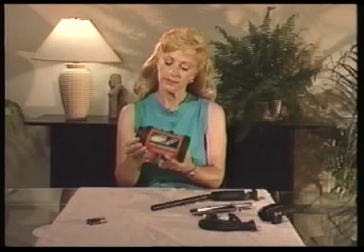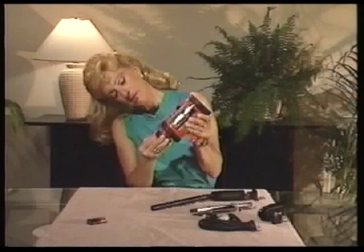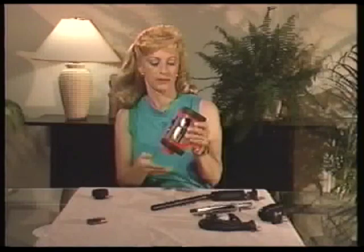To start your speedlight assembly, place the batteries in the head. Hold the speedlight head facing up so the battery cover is on the bottom. Loading batteries in this head-up position is a good habit to get into, so in the future water will not get into the battery compartment should you need to change batteries after a dive.